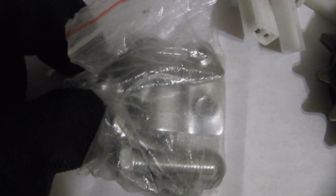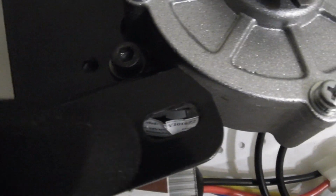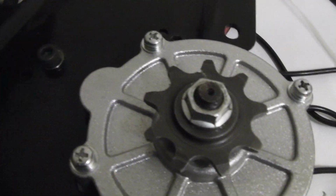and this bracket, which comes with the electric motor, mounts on the rear frame of the bicycle with these saddle clamps provided. Now these are only soft aluminum, so under stress you would probably want to change these to something a little more durable, although so far I've gotten away with using these soft aluminum threaded saddle clamps around the bike frame, which mount on these two holes here, here, here, and here. Sorry about the black on black production here.